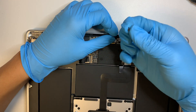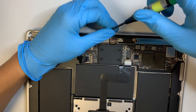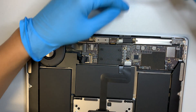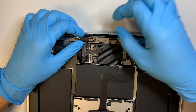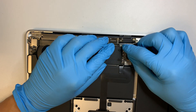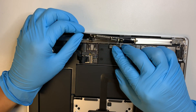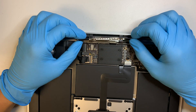This is the bigger screw — we have two more screws to go. At this point you can use a fingernail to open the flex cable. There are three brackets that hold on to the flex cable, so go ahead and disconnect them. Once you have those disconnected, as you can see, this is the LCD controller board — it is free now.